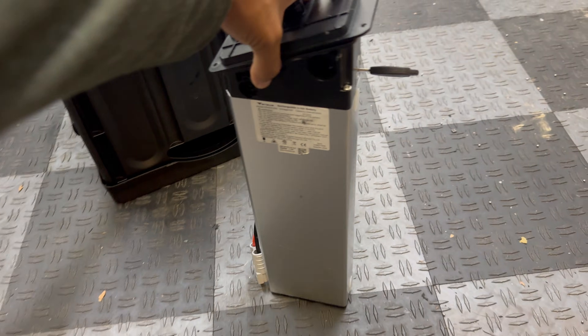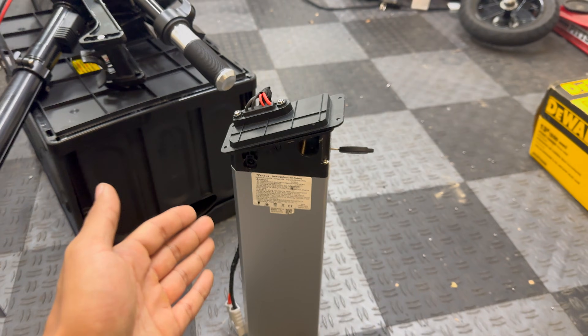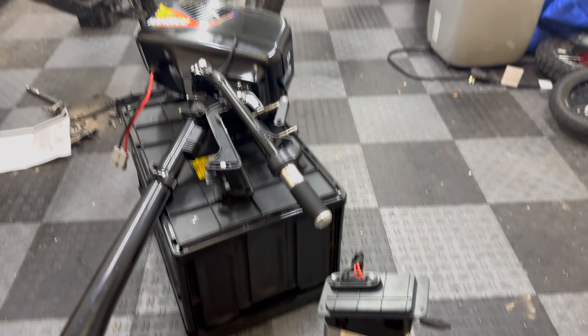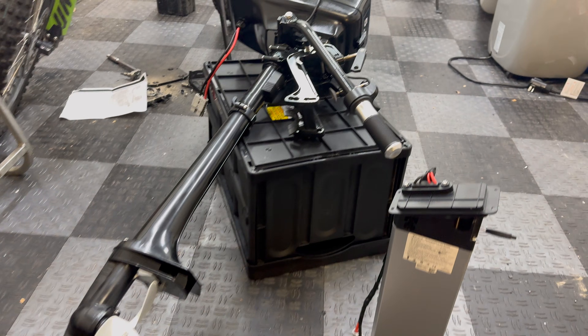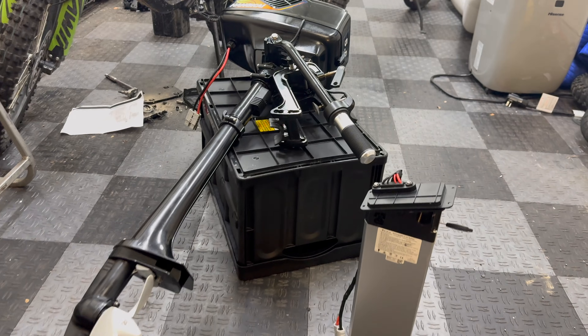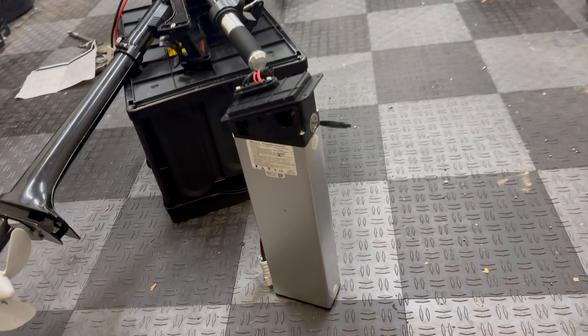This is the previous lithium battery pack that we used for initial testing — just a 16 amp-hour 52-volt battery that I borrowed from one of my e-bikes. This outboard ended up pushing the 12-foot john boat to six miles an hour consistently, but it only lasted a little over three miles since this is such a small battery at only 16 amp-hours.